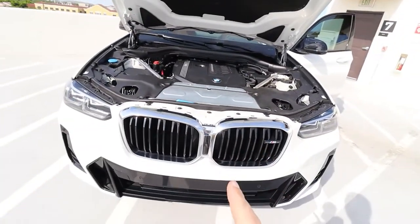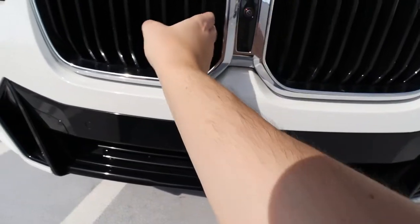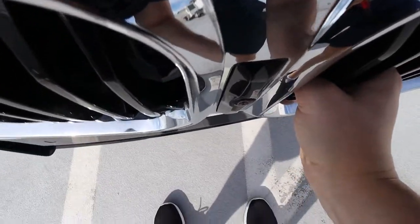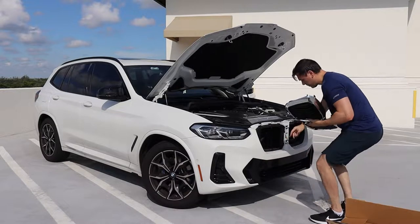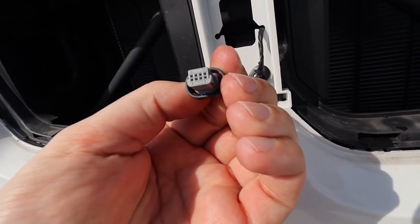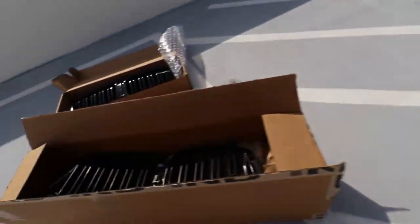So here's the final result of removing the grille. One top tip: these two middle clips were a little bit more difficult to come out at the top. What I had to do is use both my hands and just wiggle and pull. So this whole thing pops out and you can see here is the camera and the clip where it's connected. So let me disconnect that. There's just a little clip — you have to be very careful — it has, I think, eight prongs. All you have to do is squeeze on the side and it will come loose. And here's the camera.